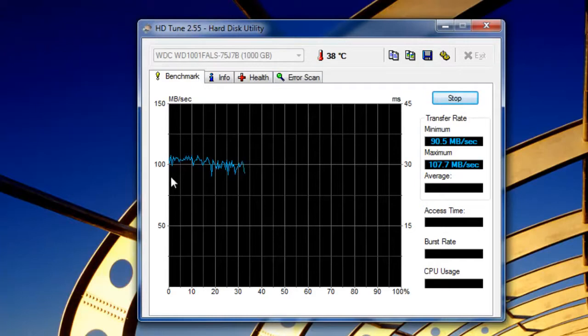The access time is the time from when the hard drive receives a command to when the armature finds the data. The reason why defragmenting used to be such a big deal is because heavily fragmented data has pieces scattered all over the drive. The armature goes to one piece, takes the access time, then moves to the next piece, adds the access time again, and so on. The more fragmented your data, the more the armature had to move around, and every move adds to the delay before data starts coming in.